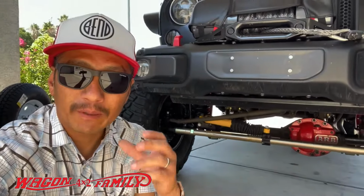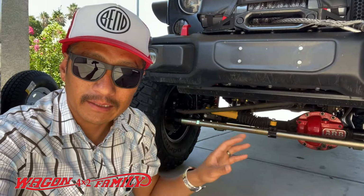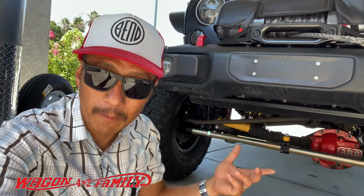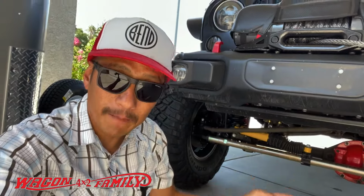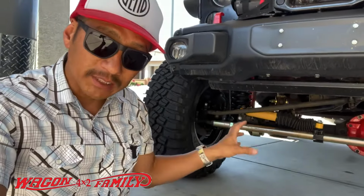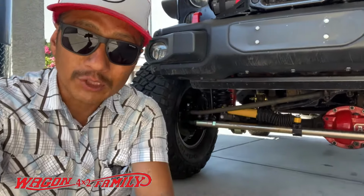All right, guys, so I'm gonna keep this video short and sweet and to the point. Now, I had some death wobble issues a few months ago when I broke my stabilizer shock on the Rubicon Trail. And when I came down, I experienced a ton of death wobble because, well, I broke that stabilizer shock, right? So then I replaced pretty much most of my front end suspension. I didn't replace one of the bushings on my upper control arm, which I still need to do.